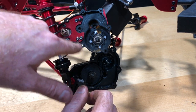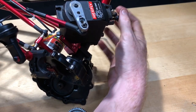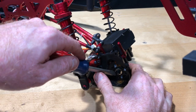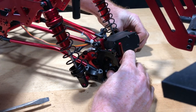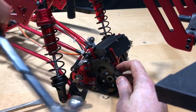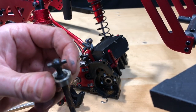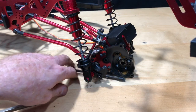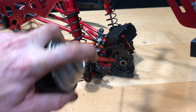I'm going to clean this up but I also need to remove the other steering knuckle that's here. We're going to go ahead and get this e-clip out of here and get that drive shaft off. Because it's rusted, I'm going to have to tap on this thing a little bit. Okay, yep — there's the bearing. It still spins and everything, might keep it or might not. You can see all that rust on there too, nasty. I'll get this bearing out, clean this all back up, and spray this thing clean.